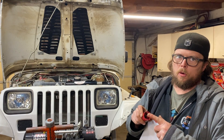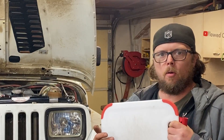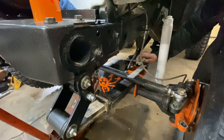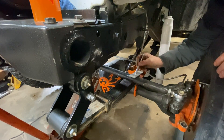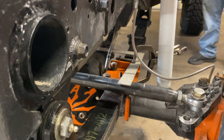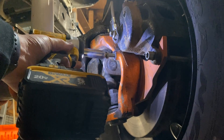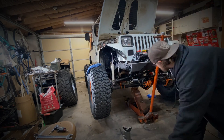After you cut the discs, they'll all have a small pilot hole — step that up to one inch or whatever size your ram is. Before cutting, you need to figure out exactly how far to limit it. Jack the front end up off the ground, get a straight edge, set it on top of your tie rod and clamp it in place. Then turn the wheels all the way left, mark the tie rod, turn them all the way right, mark the tie rod, and measure that distance — that's your max travel. Make sure your steering stops aren't limiting you first, because once you limit the ram, you really don't even need steering stops that much.